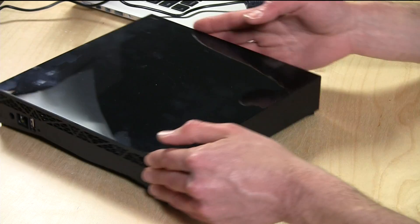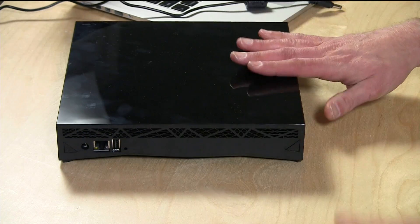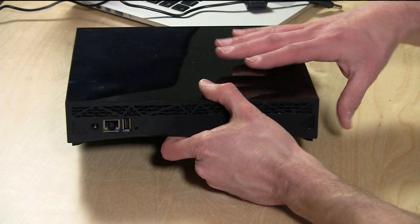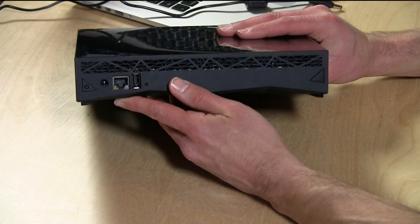It's pretty simple as far as its overall connectivity. You have your gigabit ethernet port here on the back, as well as a USB 2.0 port. Now these cannot be connected directly to a computer. Because it's a network attached storage device, it connects to your network via the gigabit ethernet port. It does not have wireless built in, so you can access it wirelessly once you get it hooked up to your network with the hard wire, but you cannot just connect it to your wireless network. You'll need to put this close to where your router might be. I have a video that I'll link to below which explains all these connectivity options to make sure you can get the best performance out of it.